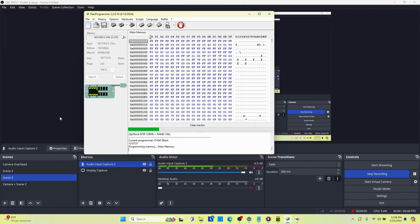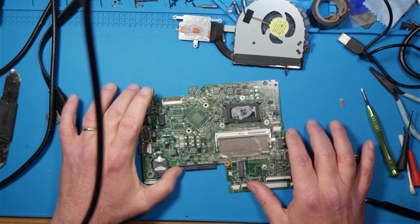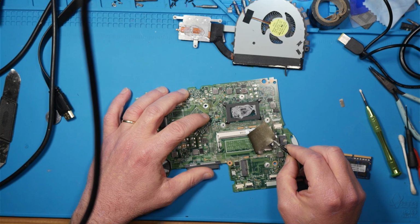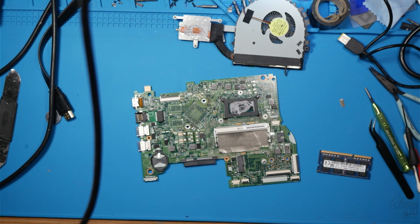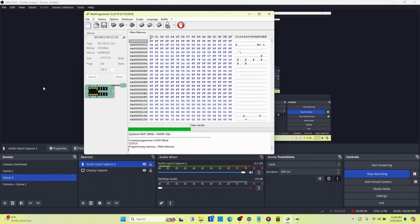So what I'm doing now is I found a BIOS for a Yoga. But it was the same motherboard. Here, I'll show you the motherboard. So the motherboard revision was under here, and it was the LT41 SKLMB 14292-1, and when I Google that, it gives me a BIOS, or on Badcaps forums, it is giving me a Yoga BIOS. That's the only one I could find. So that's what I'm installing now onto the BIOS IC. And then I'm just going to try it.